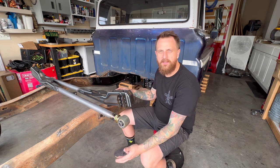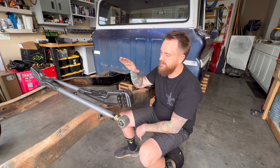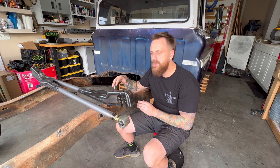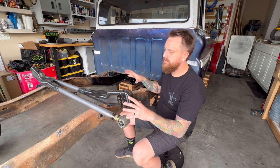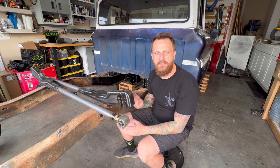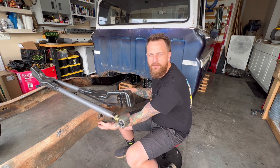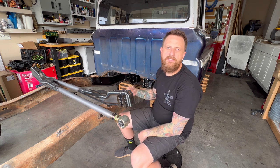That's why I'm bolting everything back together, making sure I have the center line, because I have these aftermarket trailing arms, so they could be a little bit different than factory. Although everything seems to measure up and be close, we want to just test fit everything we have, get the mark where we need it to be, to center the notch. Then I'm just going to clamp in the notch to the frame, measure everything up, get it pretty tight, and then I'm going to tack weld it.